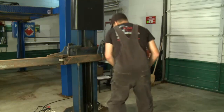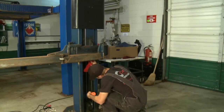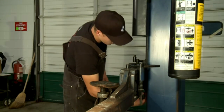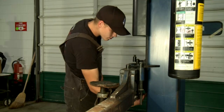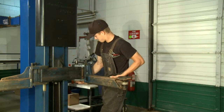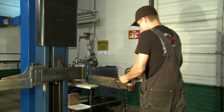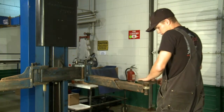For example, make a daily examination of the cables and chains for wear, and ensure the safety latches are engaging and disengaging fully. If you're using a twin post lift, check the operation of the arm restraints and make sure they disengage and engage fully.